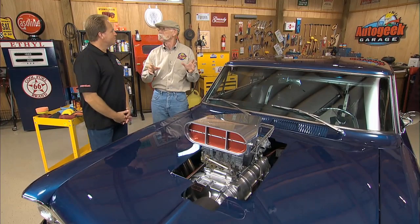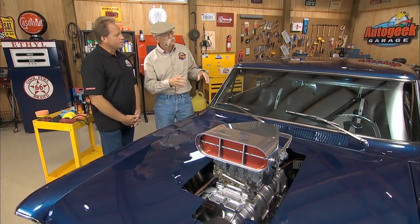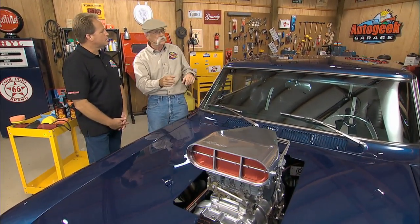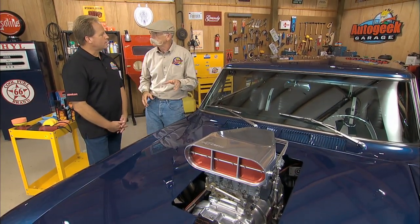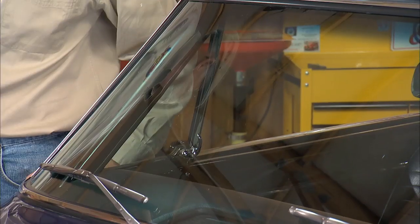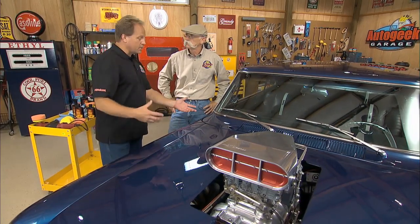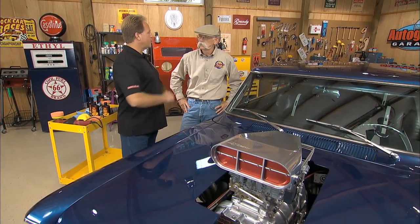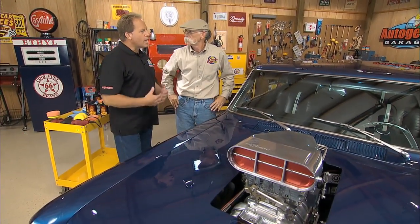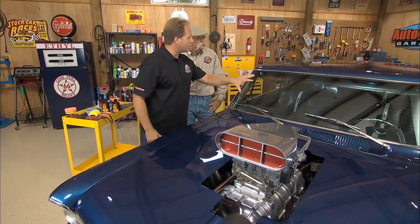When you're going down the road, you want to be able to see where you're going. That means you need good, clean glass. It doesn't look too bad from a distance, but if you get up close you can see there's a lot of grime that doesn't come right off. A lot of times you get what we call road film. Every car that leaks oil leaks it on the highway — it rains, that gets mixed with the water, throws it on the car. You get stained paint. Guys oftentimes wash and wax the paint and that gets that off, but they don't do anything to the glass. Can it just take a glass cleaner? No, a normal glass cleaner isn't going to remove road film and water spots because they're mechanically bonded to the glass.